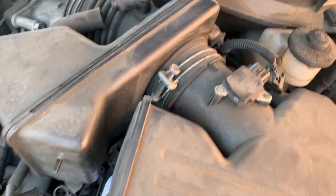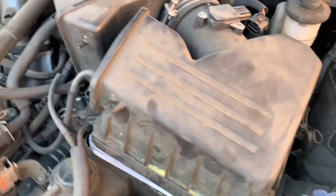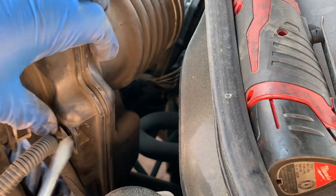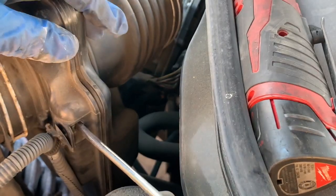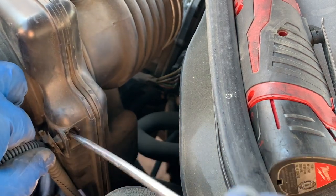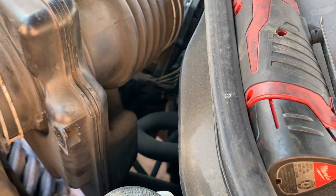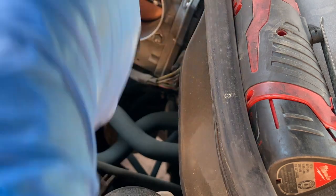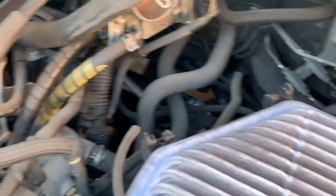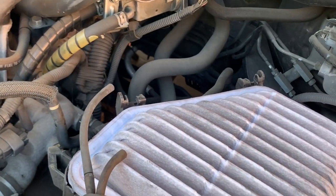Go ahead and disconnect this little line right here. Now pull it out — this one right here. There's a hook inside; use a flathead screwdriver, put it in here, and after that just go ahead and wiggle it — it should come right off. Just remove this out of the way. On this last connector there's no click, so you have to push it back towards the throttle body in order to pull it out.